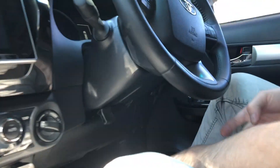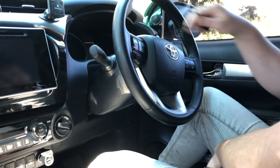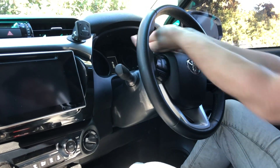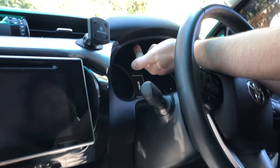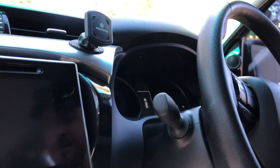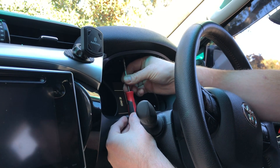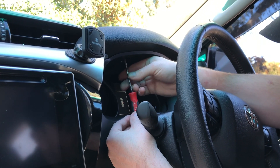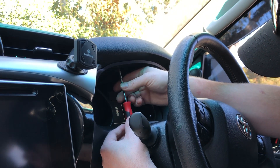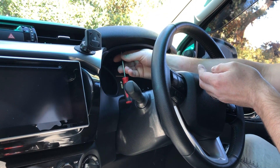You want to release your steering wheel column — pull it back towards you and down — because that gives you room to remove the shroud around the speedo. That's your first step. There are two little screws straight up under your speedo, one on the left and one on the right. These are little plastic scrivets with little Phillips heads — go in the middle and give them a light anti-clockwise turn. You don't want to push too hard because they're plastic scrivets, not screws.